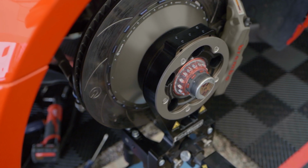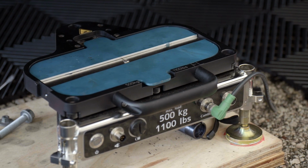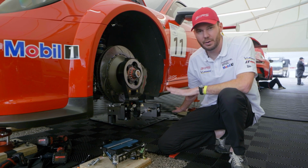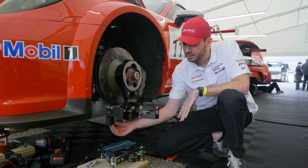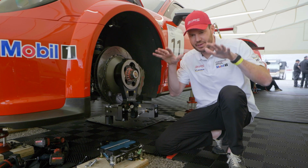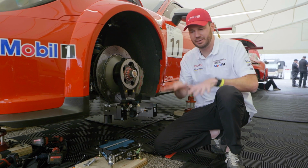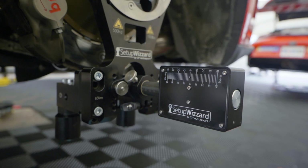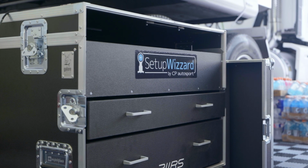The car's on air jacks. It'll go back down on these pads. These are, at the beginning of each weekend, all leveled, laser leveled. They're perfectly flat, all four wheels. These little rollers right here let the suspension settle and let the rollers move out so everything settles as it would if the car rolls. You used to have to roll the car forward, roll it back to get it to settle right. So this system basically is incredible for our guys. It makes everything easier, quicker. It's important to have a system like this.